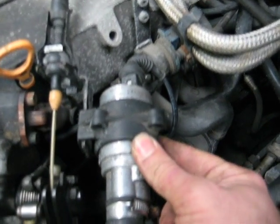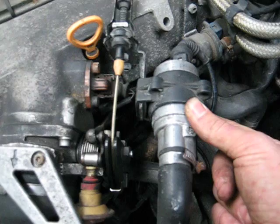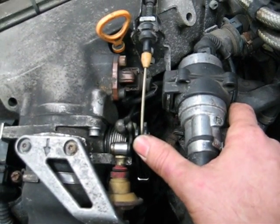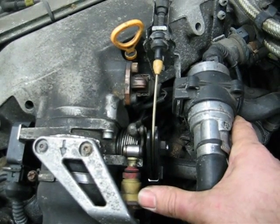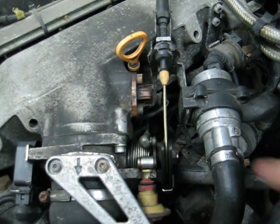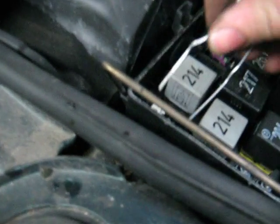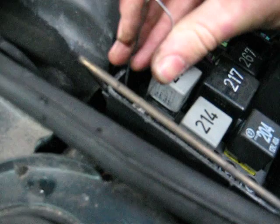There goes the idle air control valve. It'll keep on cycling until you hit the throttle. Every time you want to change — like for example the injectors — you just click it. It's not the throttle valve anymore, that was for the injectors. Now what you got to do is you come and jump these two. You hear it cycling, and then you count to four.